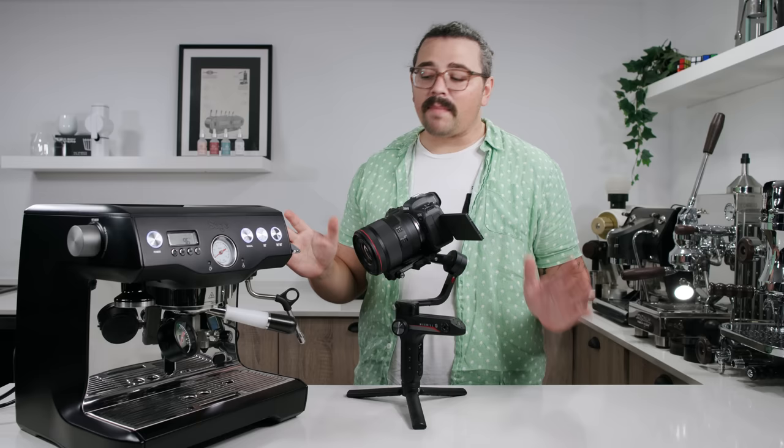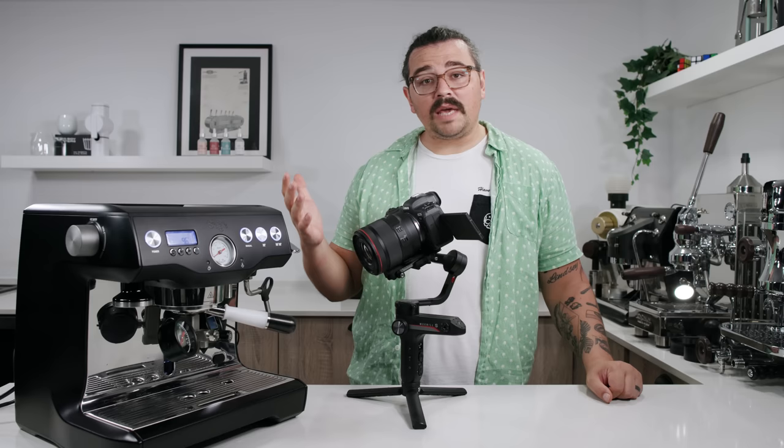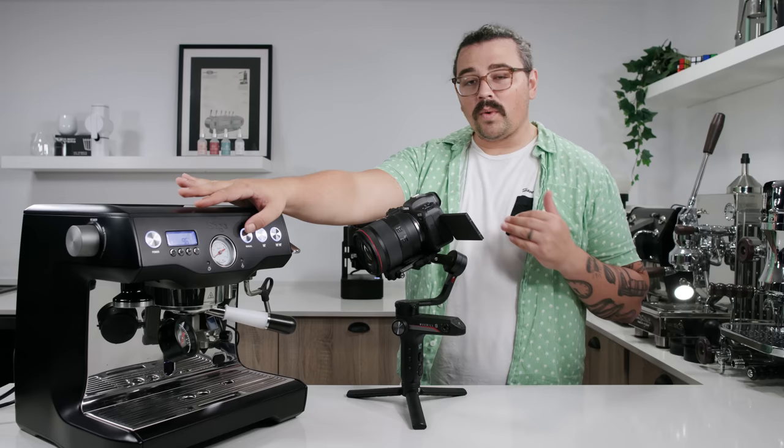I have this camera right here so you can actually watch it as it is going throughout the shot. I do have the SCASE, but it's been acting up lately and temperatures have been going from like 90 to 105. I don't know, it's something with the probe, I think. I've done a lot of comparisons between this and the SCASE, and if you allow for warm water and a longer shot time, it will give you pretty good measurements. Keep in mind that there is that cavity that needs to be filled with water. I did leave a little bit of hot water in there, so we're currently reading 89.2 from a previous flushing. I wanted there to be something to emulate a puck because there's nothing in there to do so. But anyway, you can watch the temperature right here. We're gonna go ahead and click and we'll just let it run.